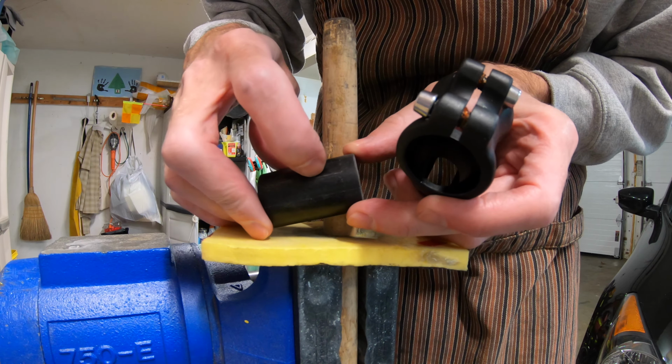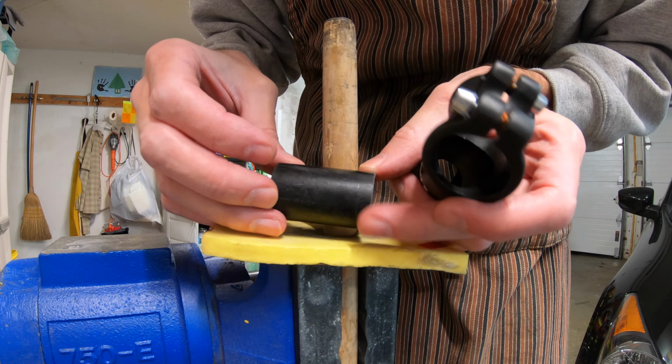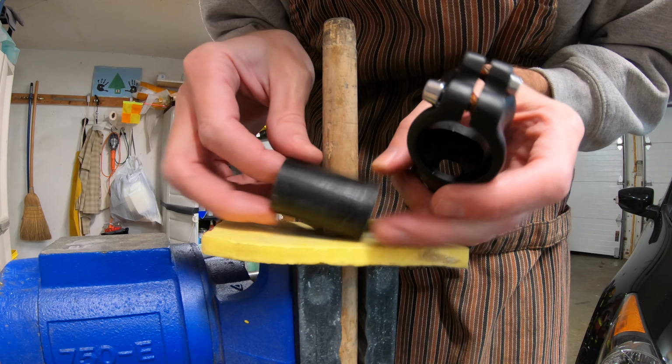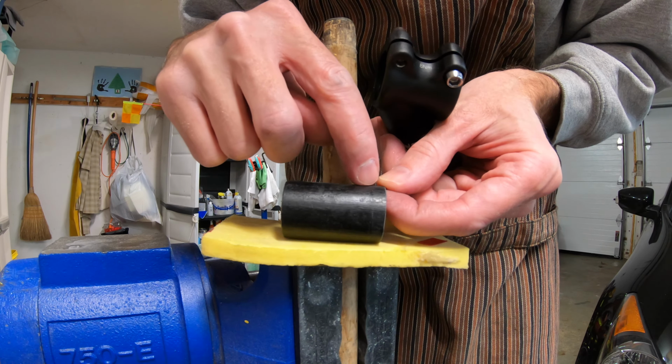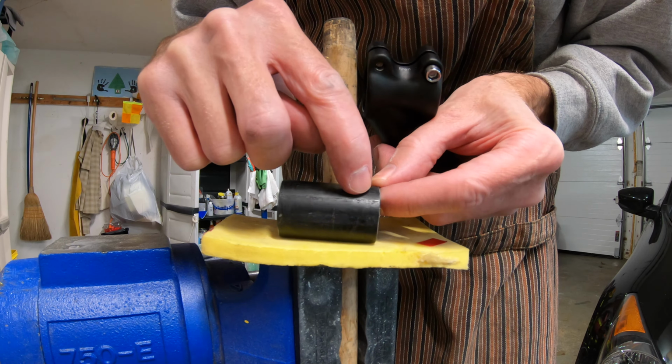I don't see anything obvious except maybe there. You can definitely see compression lines along there, so the whole thing does look squeezed in. It's kind of bone shaped now where it was compressed. And of course, if you had it over-compressed like that and you were reefing on handlebars, levering it back and forth, you'd probably have an even lousier time. I would say that that little line there is probably our crack, and we heard that slight cracking sound.